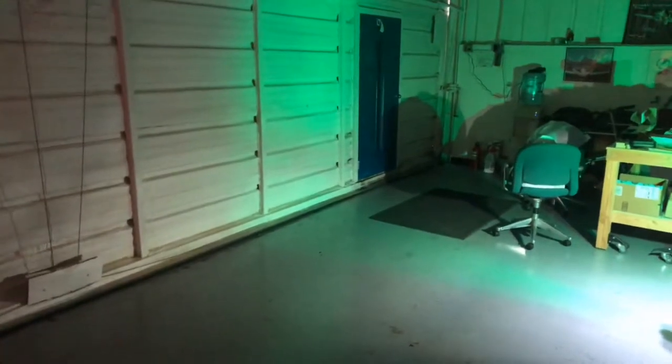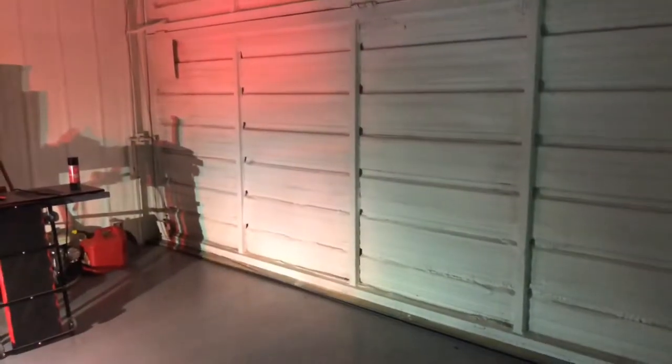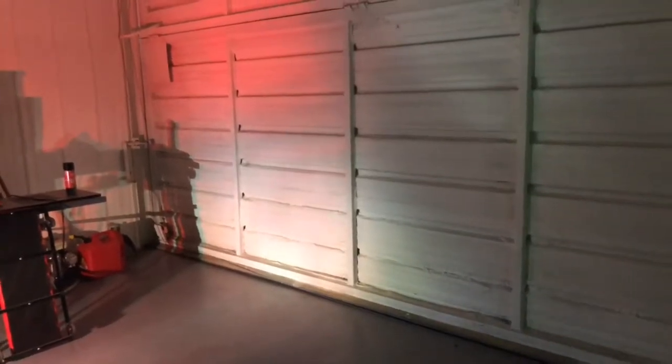That's landing and taxi with the strobes working. There's a nice dispersal pattern out the front of the plane, and that cover actually adds a little more dispersal to the light. We're getting more of a forward-facing light. With the other lights off, you can see just the nav lights on. When I go to taxi light, you can see that wide dispersal pattern. Then switching to landing, you see how we get a spot facing forward. The dispersal pattern is quite different and we get a forward-facing beam.